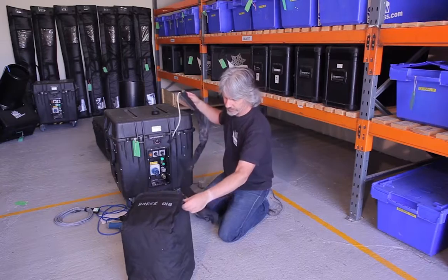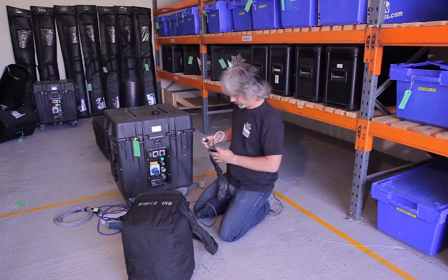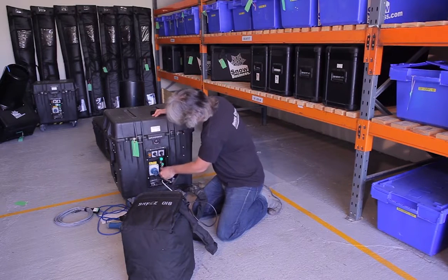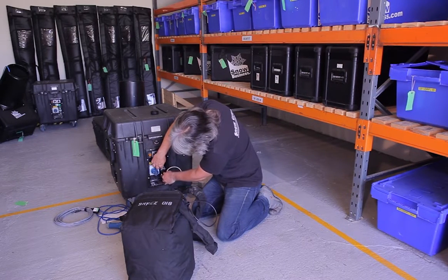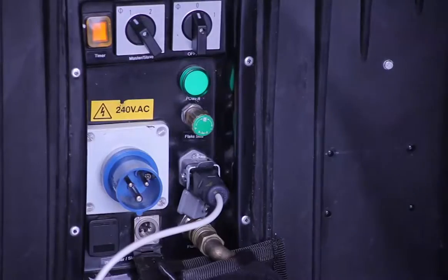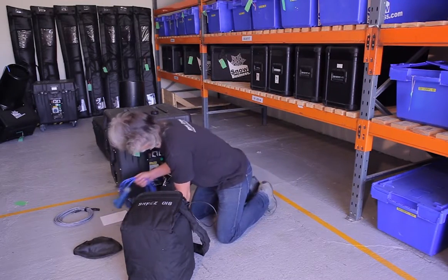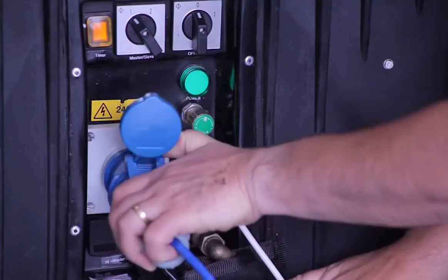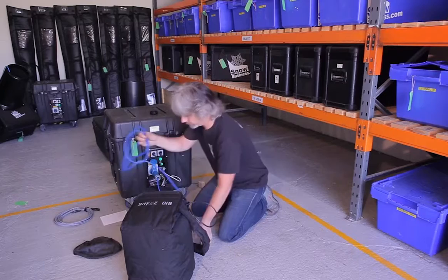This is the insulated line, which has two connections. The fluid connection goes in at the bottom, and above that is the heater connection. Remove the dust cover, take the heater connection and pop it in — it only goes one way round. Push it in firmly and click down the retaining clamp. That's the fluid line connected. Finally, connect the power lead — it goes on here. Hold it and pop it on, then the other end goes into the 13-amp UK plug.